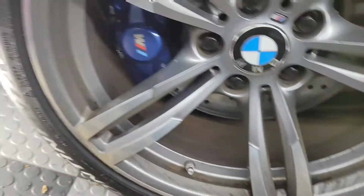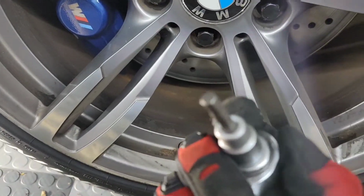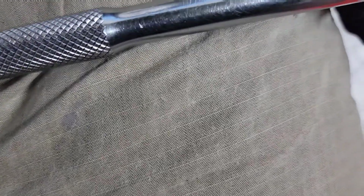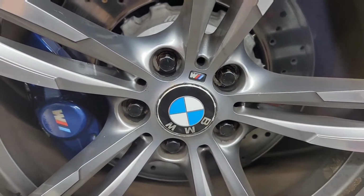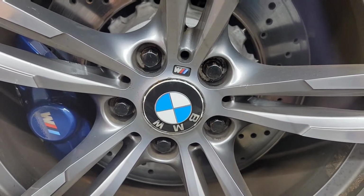Once I've broken the bolts loose, it's just my process. You don't have to have it. And then to get the rotors off, this is an Allen key. Of course, it doesn't have the size on there, but it's a pretty standard size Allen key. To unlock, there's 2 screws on the rotor, and then basically everything slides off and goes right back on. So that part is actually pretty easy.